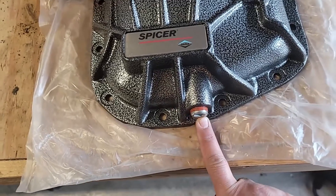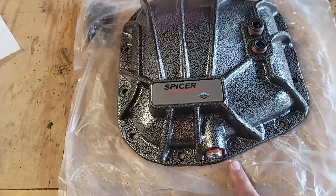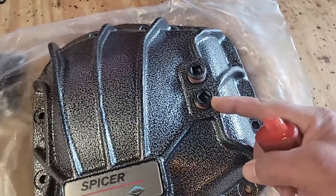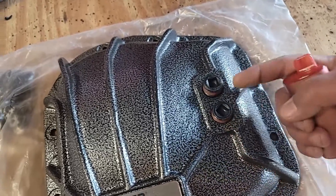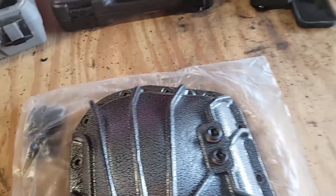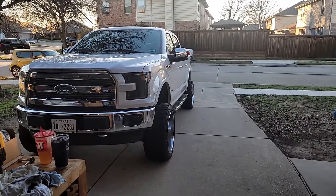What's important to know is that it actually has a drain plug on it where the original does not, so you can actually change your fluid out at regular intervals. The lower plug is the fill plug for non-lifted vehicles and the top one is for lifted vehicles — his truck is lifted with a six inch lift on it.